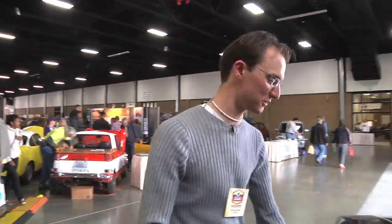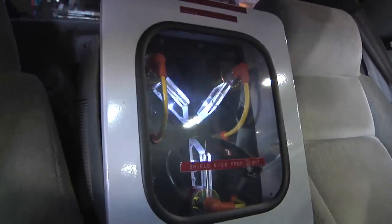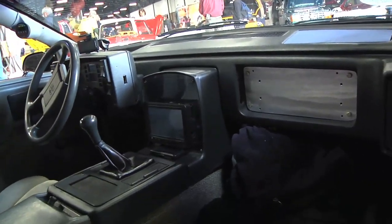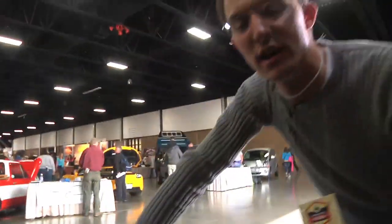I charged it up in under two hours. The lead pack is pretty small but gives me about 30 miles of range — I drove from about 30 miles away and charged up quickly. If you want to see inside, my friend and I put in a flux capacitor. I also put in a seven-inch color touchscreen, and back under the dash there's a small car computer running Windows for my own stereo. In the future, when I get the lithium BMS installed, I'll be able to monitor all the cells and get good battery information.